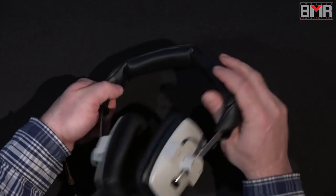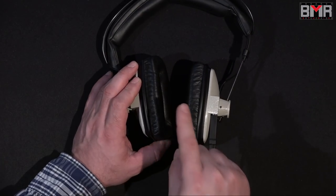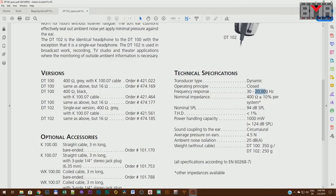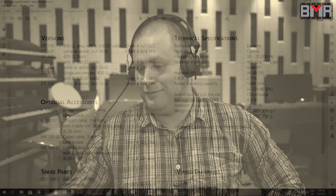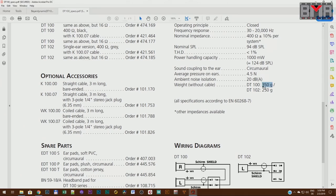It's an absolutely professional headphone. The most important job in your mic room will be done by this headphone, and the most important feature is the side isolation. You can order a few different versions from the DT100 family — one is normal stereo and the other is mono, and it exists in a black color, but I really like this old German military-style gray. It can go from 30 Hz to 20 kHz, but has a kind of high total harmonic distortion. It has great power handling — it can handle one watt of amplifier power at 400 ohm. The pressure on your ears is 4.5 newton and the weight is around 350 grams.